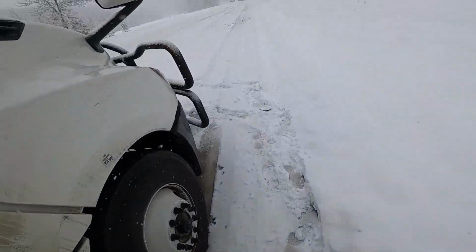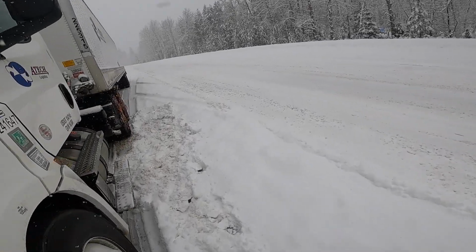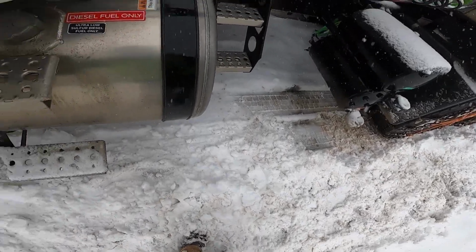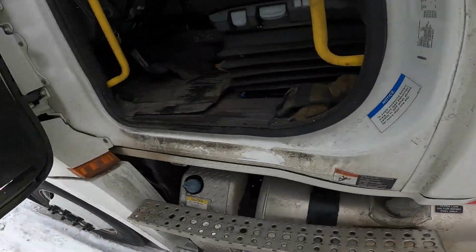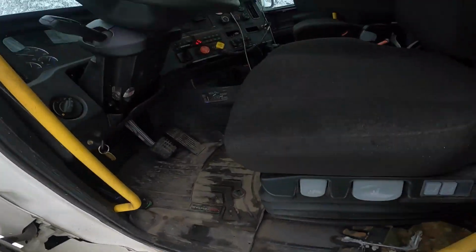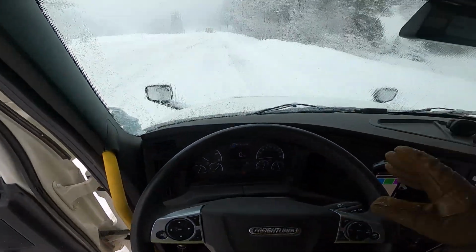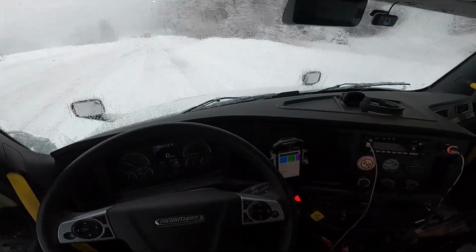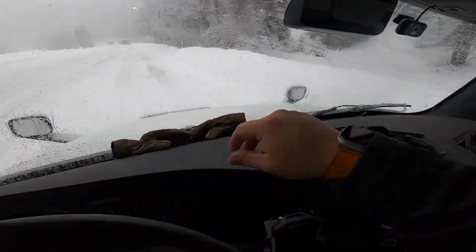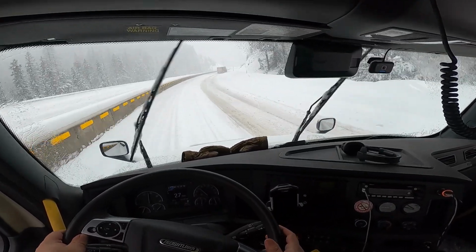I've gotten everything put on. Now it's time to drive. As far as lockers, you don't really need the lockers, but because of the snow conditions here, I did the interaxle lock, which kind of puts it in 4x4 mode. That'll mean 1 tire in the front and 1 in the rear drive axles will be guaranteed to get power.